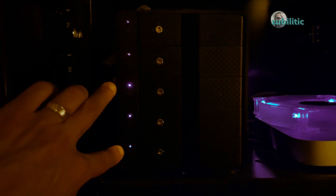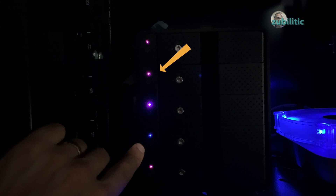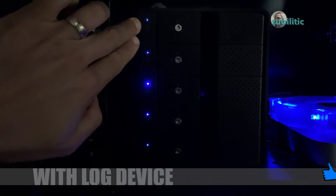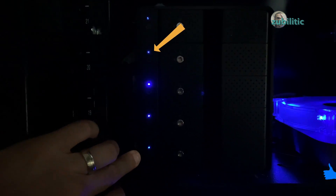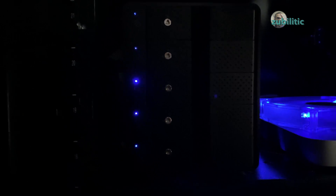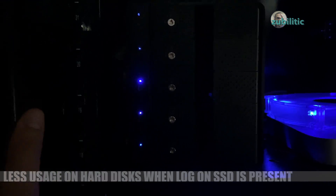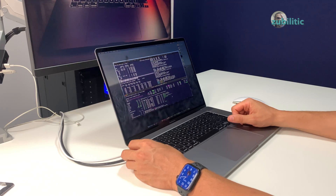This is how disks are utilized continuously when there is no log. This disk has the ESXi datastore so it's not used as much, but these ones are part of the RAID and as you can see they are used continuously. As soon as you add the mirror log device which resides on the SSD, you see disks one, two, three, and five — they are no longer used continuously. This is one of the very important benefits of adding a log device. I hope you found this useful; please let me know if you have questions in the comments, and see you in the next one.